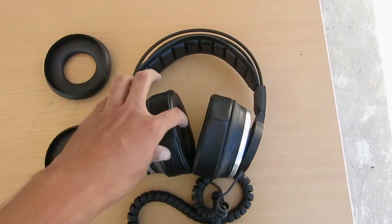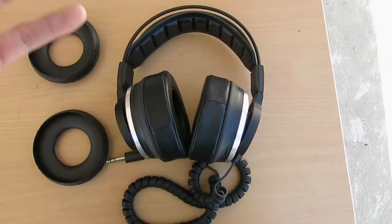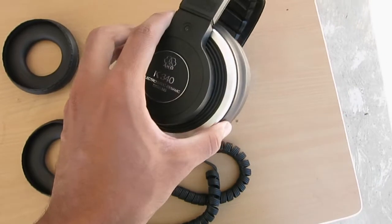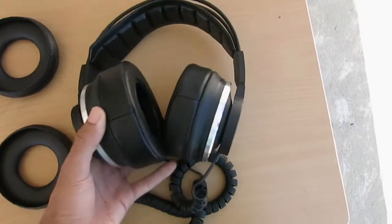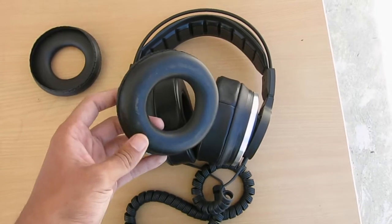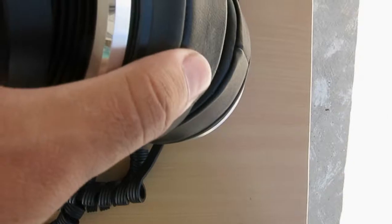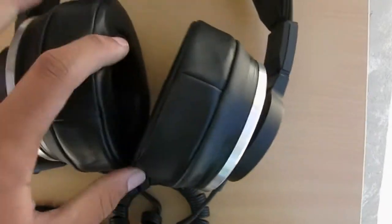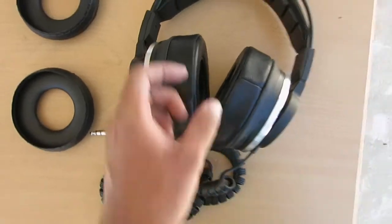One thing I do like is that the comfort of the headphones is now improved significantly — these are so comfortable to listen to. When they sit perfectly and create a good seal on my head, the sound is improved greatly because it creates a slightly wider soundscape. The bass is improved a little bit too because these are really thick leather, giving more room for it to reverberate. However, these pads might be just a little bit too wide — the pad diameter is 110 millimeters, but I think 105 might be better, as they sag over the lip and don't fit tight, which contributes to sound escaping.